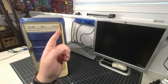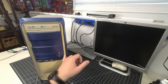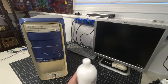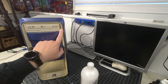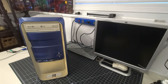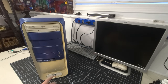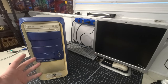For those who don't know, retrobriting is the enthusiast technique using peroxide — you can use cream or similar products. You put the plastic parts in a bag, cover with plastic wrap, and put it out in the sun. It actually lightens the plastic back to a much lighter shade of beige, similar to how bleaching works on hair.